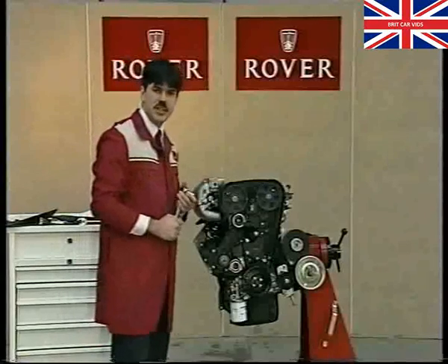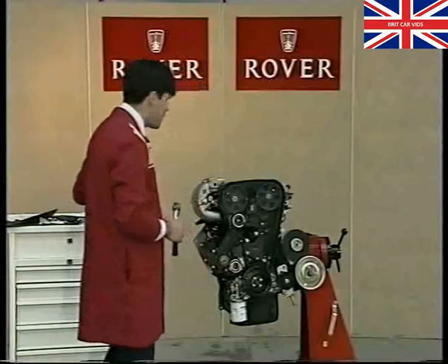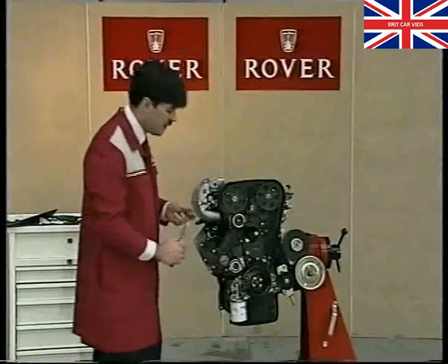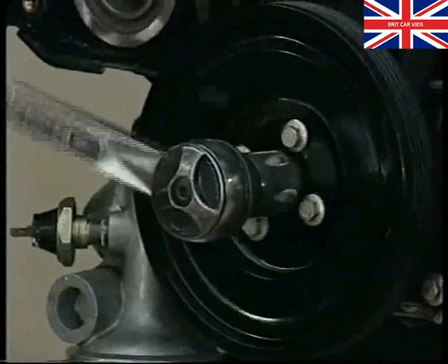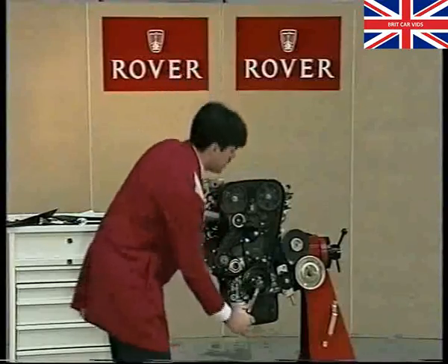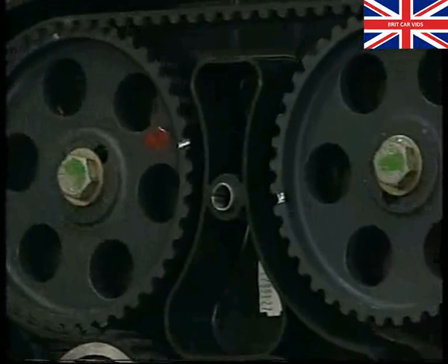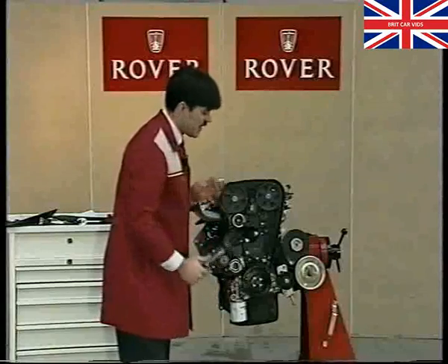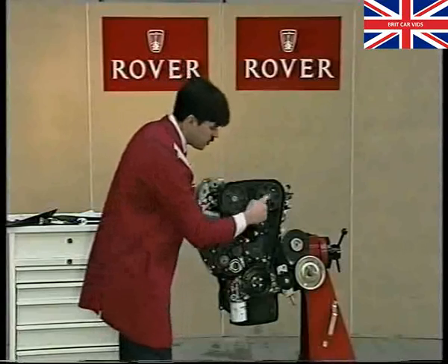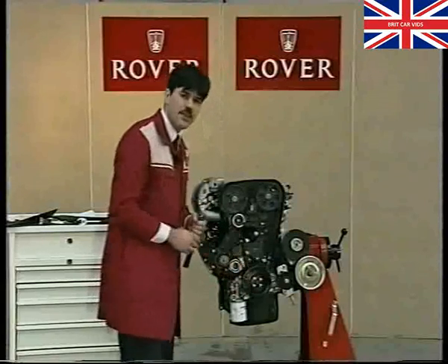With the M16 engine, we haven't got the luxury of a semi-automatic tensioner, but we found that with a little bit of care we can provide the same function using our Allen key. As with the K and T-series procedure, we turn the engine through two revolutions until we get those camshaft timing marks aligning again. There's no need for any degree of accuracy here — you don't need to fit the camshaft locking tool and the flywheel pin at this stage, it's just an approximate alignment. With that done, you'll find that all the slack has been pushed round to the slack side of the engine, and we can now take it up with our tensioner pulley.